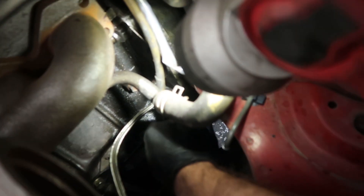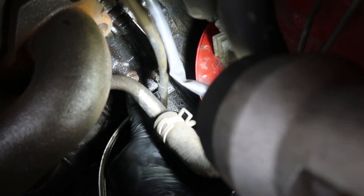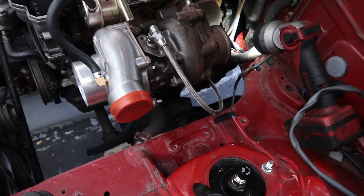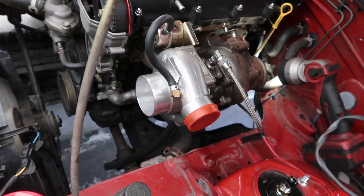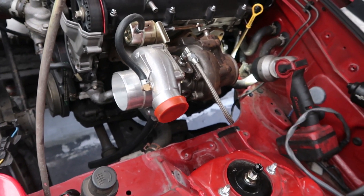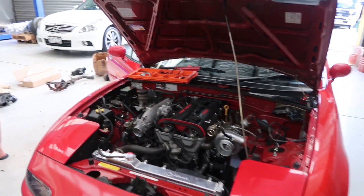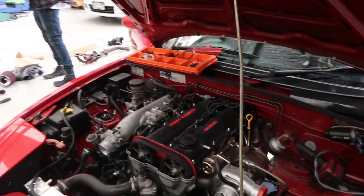Update! I was pointing to the wrong one. I completely forgot that the oil feed's actually a little bit further down here. There's two bungs - don't use that one, that's your water. So here's your oil feed down the bottom. One nice braided oil feed line, and we're just about to drill a massive big hole in the sump, which is the scary part of this whole process. Glen is making some brackets for the intercooler so that's going to mount up there. And honestly, we're like 12% done - so Matt's looking about 12% excited and Glen's looking about 12% annoyed. Let's crack on.